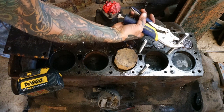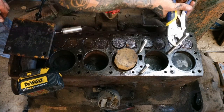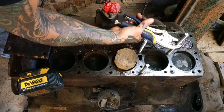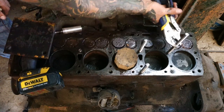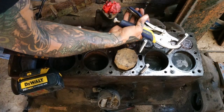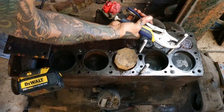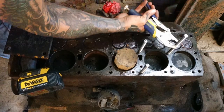This method is way better than popping the clutch or anything like that because it doesn't put stress on any of the drivetrain, and you have a wood block on a piston so it's not damaging that. This is the least destructive way to do this. We've done this with several motors that went on to be running motors without a rebuild or pulling any pistons. Obviously that's not a guarantee. You want to have full thread engagement — at least an inch of thread — because you don't want to be pulling threads out of your motor.